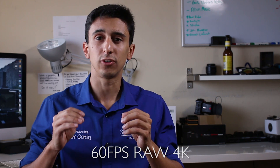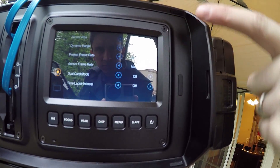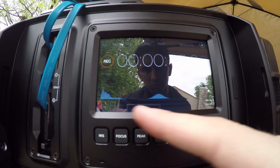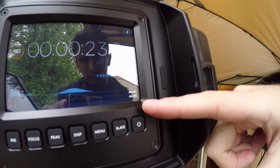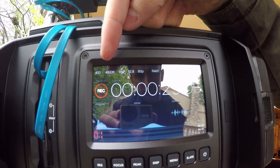To show what the C-Box system can do, we wanted to run it through various frame rate and resolution tests to make sure it's capable of handling those high-speed transfer rates needed to avoid dropped frames. The first benchmark test was a 60 frames per second 4K uncompressed resolution recording until both SSDs timed out. We have dual card mode on, because that is what this camera is designed to shoot on with C-Fast cards. This is your camera writing the information to the card — you can see we still have just over an hour of time left shooting at 4K 60p totally uncompressed. As long as this record indicator says record, we're good — we're not dropping frames.